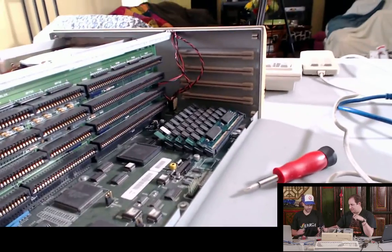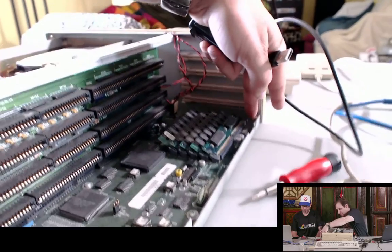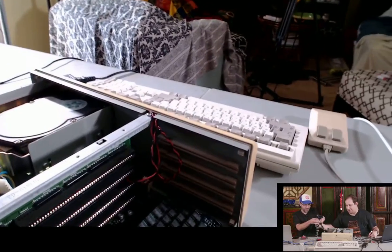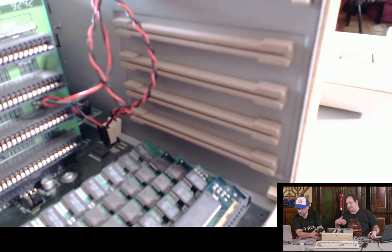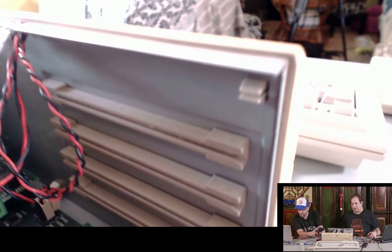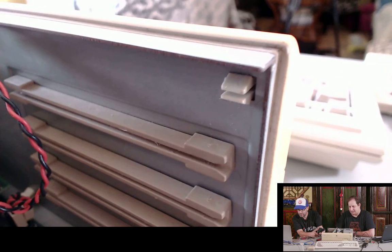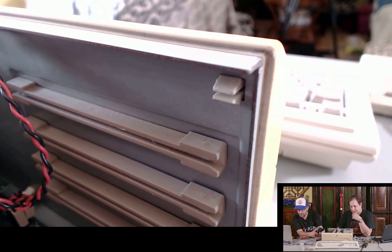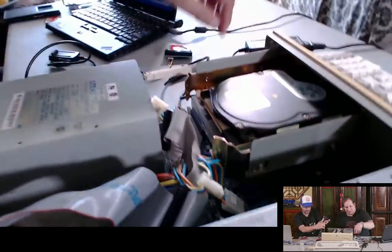Let me show the inside of the 4000 case here - these plastic tabs hold the front on with no screws. This plastic is getting older and more brittle, and every time you pop the front case off there's a risk. As these plastic tabs break the front gets looser and looser. The best bet is to try to leave that on and not mess with it - the tray holding the drive is screwed in from the front so you'd have to take the front off to remove the whole tray.